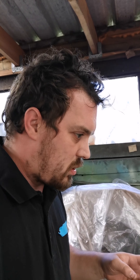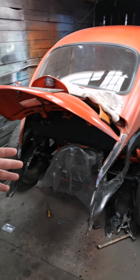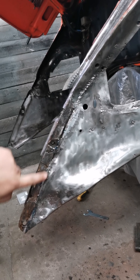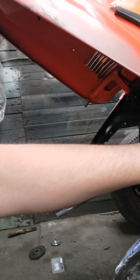The next plan of action is bodywork. As you can see, I've taken the rear apron out and I'm just attempting to clean all these welds that were holding the apron in place, which obviously weren't factory. I'm going to de-seam where the rubber seal strip is because that's a common rust trap. So basically I'm just attempting to clean all this area up — both sides. I've got parts to weld in here, over there, and obviously the side trays.